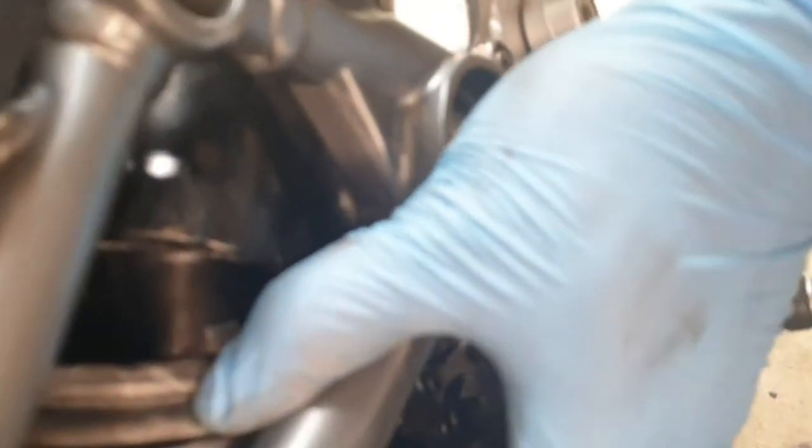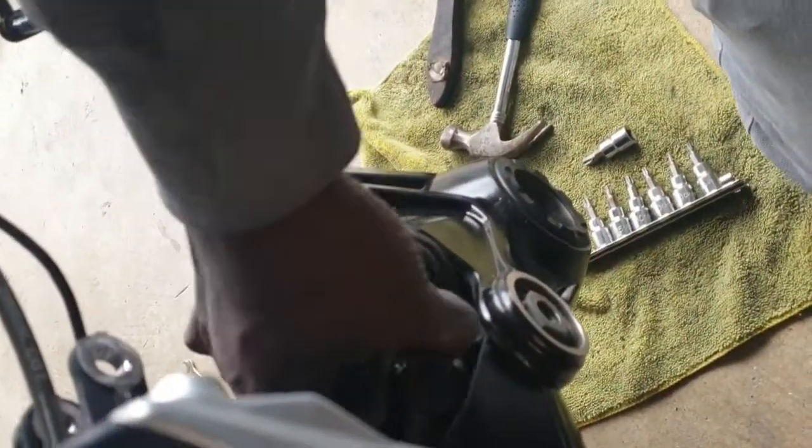Once you've managed to get the rear coupling and the spline together, slid in properly without having to force it, make sure that you put the bike in gear, just to make sure that everything is not turning when you're trying to catch the front spline. So you can turn the brake disc, and that will gently turn the shaft. This could be a two-man job, but one person could do it. So perhaps gently turn the brake disc while you're trying to maneuver that spline.